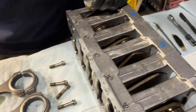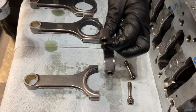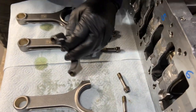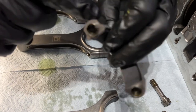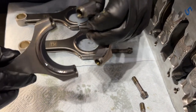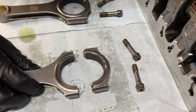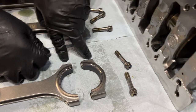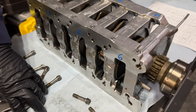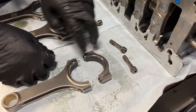So one thing to keep in mind is on these K1 rods, you have the tang side. Let me put this down. You have the tang side that has a serial number. Match the serial number, tang side. All right? Keep those in place. Jake recommends, just for consistency, the tang side towards the IMS cradle, the back towards the IMS baffle tray, just for consistency.